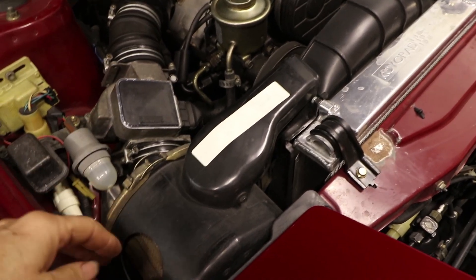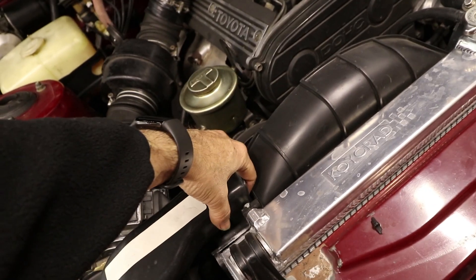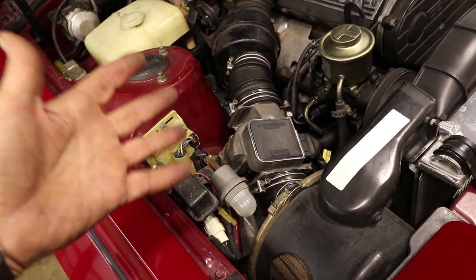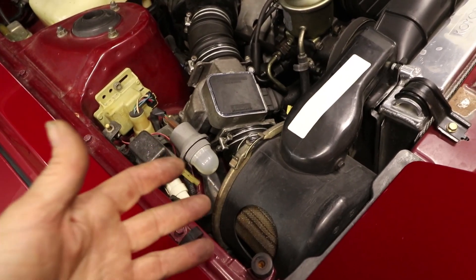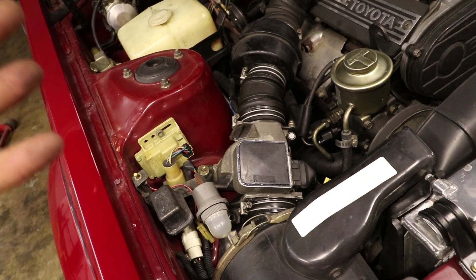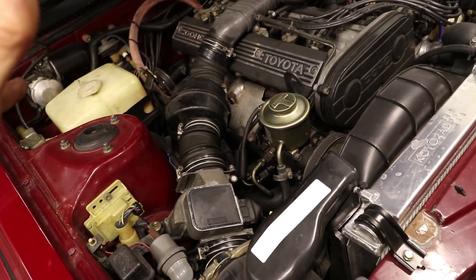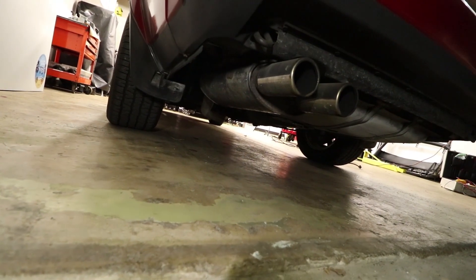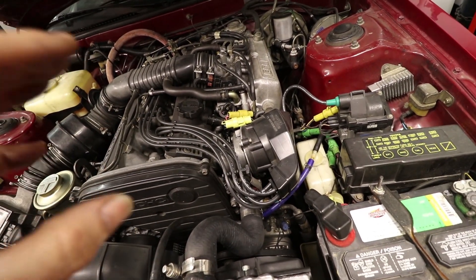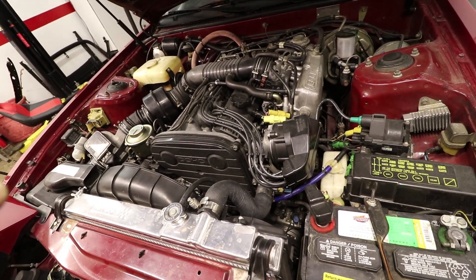The other modification is the air box has a hole drilled in it that's not normally there — normally all the air comes in the small stock hole. That could improve airflow a little and cause it to run slightly lean. I'm not convinced of that, but it's a thought. The car is driving better, but a little more tweaking on the spring tension inside the AFM might be the ticket. This is what the exhaust looks like — the catalytic converter is still there. Spark plugs, wires, rotor, and cap are all new, so I don't think it's an ignition problem. I'm going to keep looking into the fuel system to see if I can improve it a bit more.